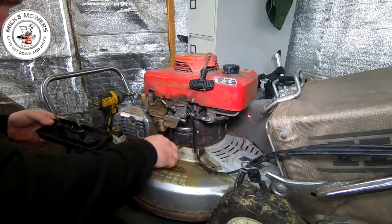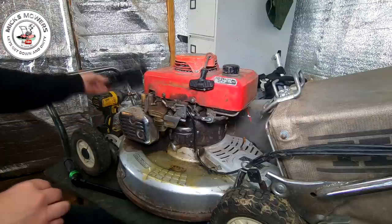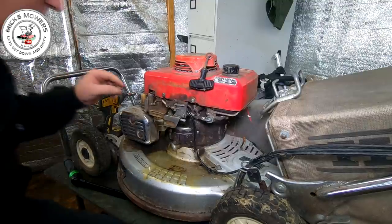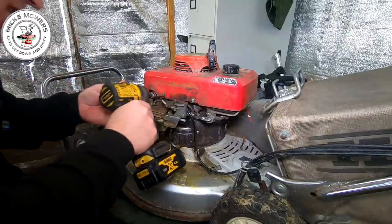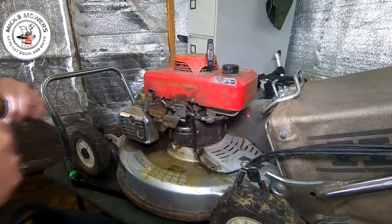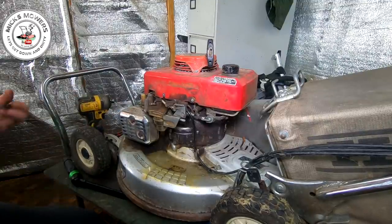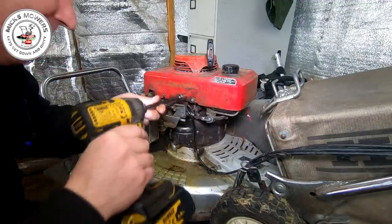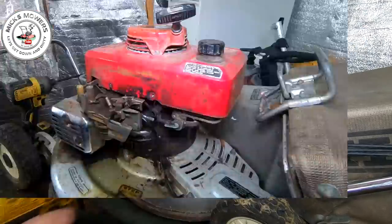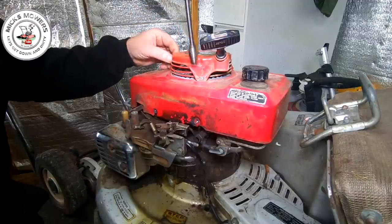Let's put these bits in the box so I don't forget where they all go and don't lose any bits and pieces. Then you've got another couple of 10mm bolts here — one here and one here to do. I might have to change back to my longest extension just to give me a bit more room. That was well on there. So then we're going to remove the pull cord housing itself just for ease of access.